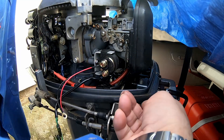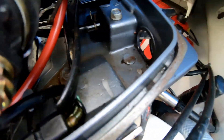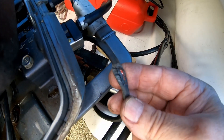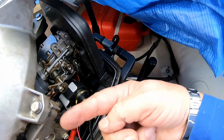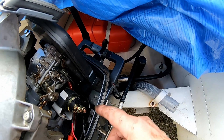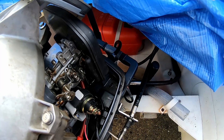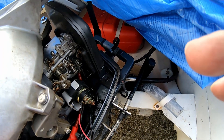One of the many things about removing this — from just there — I came across this. Looks like it's been nipped, squashed. With the two battery cables, there will also be a 5-core cable coming in here that will feed the solenoid for starting and also the 12 volt feed, with a ground running through. I know we've got the battery but I'm going to run a separate ground through as well, so we can use two of those cores to replace this safety — and that will be needed for the ignition switch, so when you turn it it kills the engine.